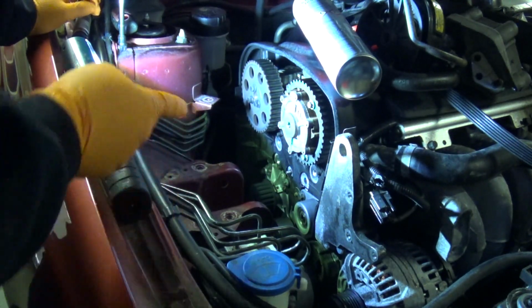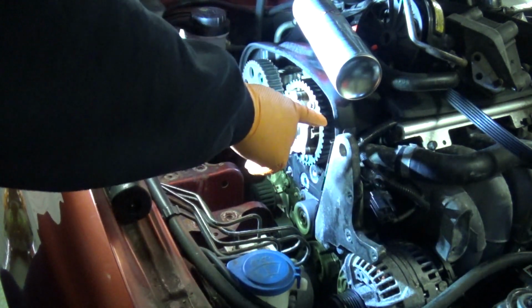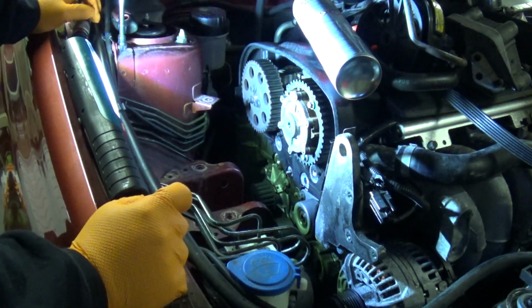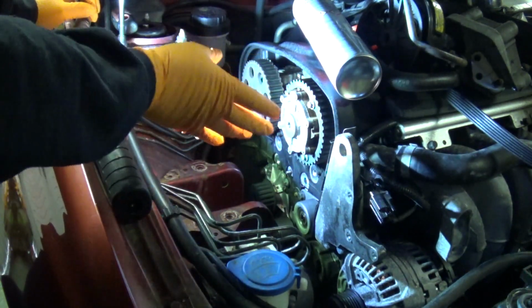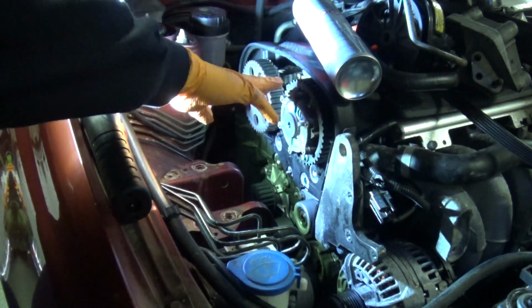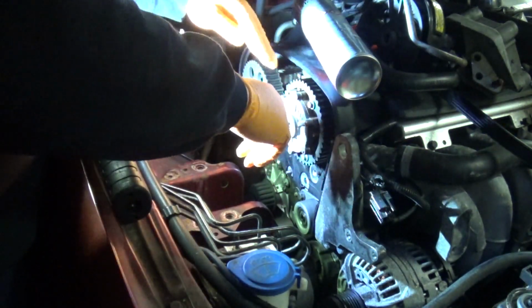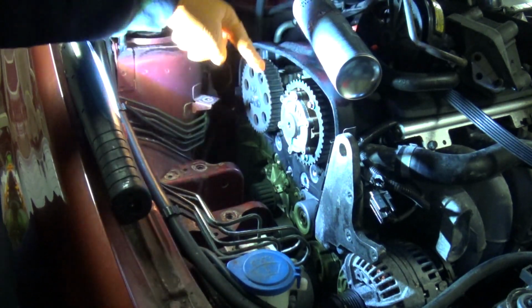The belt order is that it goes around the crank first, then around the inside of the guide pulley, and then this is probably going to be the most awkward bit. It goes over this camshaft, but because I didn't put a locking tool in place, I'm going to have to use, I think that's supposed to be a T55 in there, in order to turn that back slightly. I'm not really going to be moving the camshaft, it's just taking up the spring pressure within that hub, at least I believe that's what I'm doing, to get the alignment mark, which is there, back in line with the timing mark, which is there. It only needs to go about a centimetre or so, but it's going to be very awkward to do because you're going to have to hook the belt round and move that, and hold that while you go for the next pulley, and then it's going to be under the water pump and back over the tensioner.